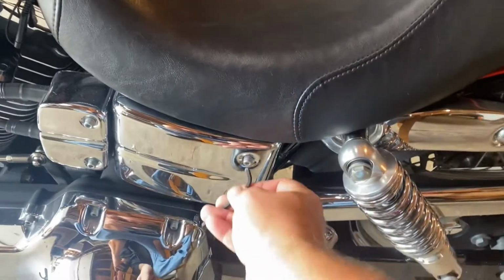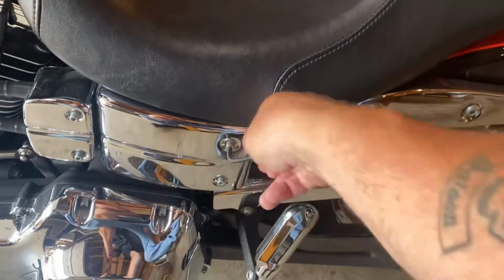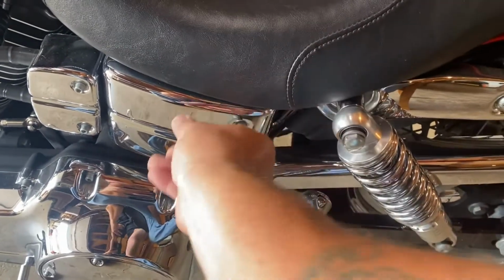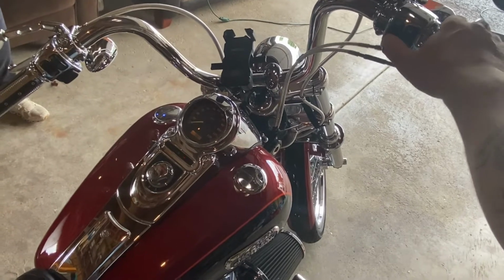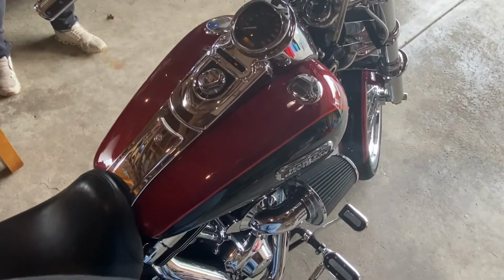Don't waste time removing the fuse box cover bolts because they're just there for decoration, and I know that now. Just give it a good tug, it'll come off, and then you can simply pull the fuel pump fuse. Once you've done that, start the bike to remove the excess fuel from the fuel pump so that you don't get sprayed.